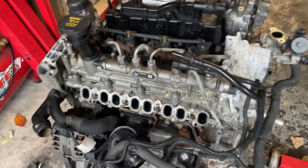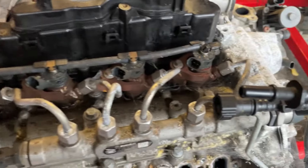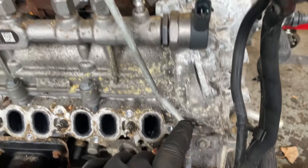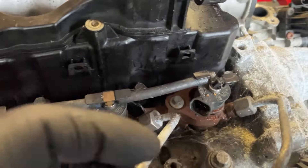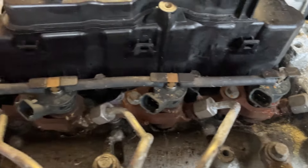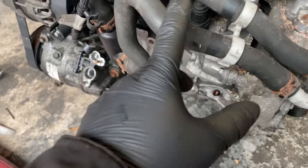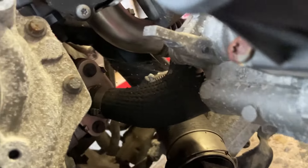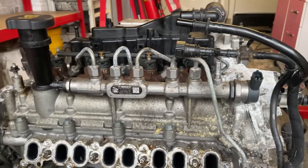The manifold's come off - no issues, nothing to report there. Now I want to get the fuel injectors out, and maybe get a video scope in there to see what's going on. To get the injectors out I need to get the rail off as well, so I'm going to crack off the high pressure fuel pump and do all of these fuel lines. The loom's already off - someone's obviously already been here. I also want to get these coolant pipes off and remove the EGR as well.